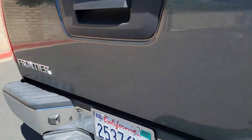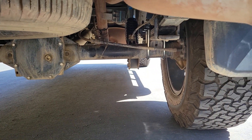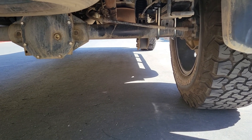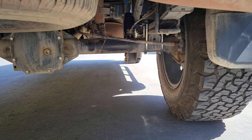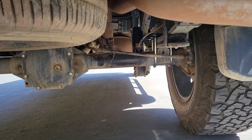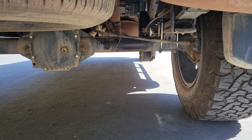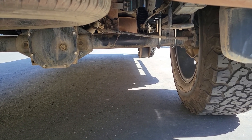In the rear I'm running a U-bolt flip kit from Deaver with Bilstein plus-two shocks. They give you an extra 2 inches to accommodate for the 2-inch travel. If you're going to add 2 inches to your rear end you've got to get plus-two shocks, because plus-two means they give you an extra 2 inches of shock travel. If you just slap on regular Bilstein shocks the thing will be topped out, it'll go clank clank clank and it won't feel as plush as it should.